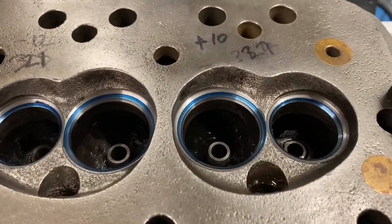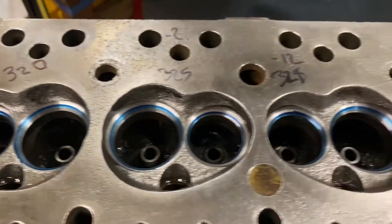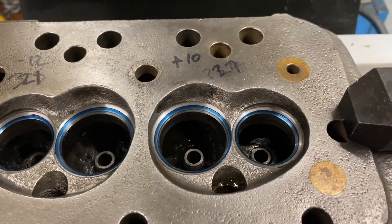I've just put some blue on our valves and tried them in the seats, and we've got contact in all positions, so very happy about that. That was a little video on just about cutting some valve seats on the milling machine. Nice basic valve seat job there - no frills, not a performance application - the customer just wanted the engine to run. Hopefully you got something useful out of that, and as ever, if you want to see some more videos, please like and subscribe. See you soon.